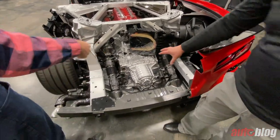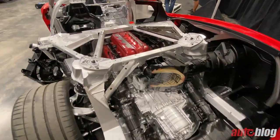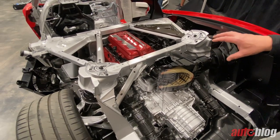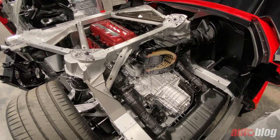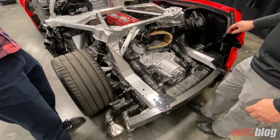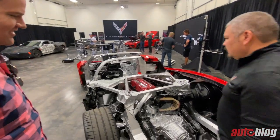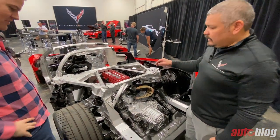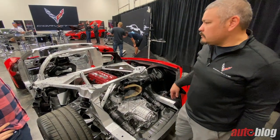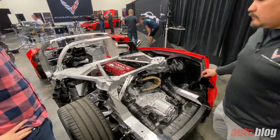The transmission is housed here, mated to the engine. A couple of considerations when you go to a mid-engine configuration like this: as the engine moves, the exhaust doesn't go down — it ends up coming up. You put the engine down as low as you can to lower the center of gravity, which is why some mid-engine cars have the exhaust going up. You also end up with an accessory belt right behind your ears, so you have to pay special attention to noise transmission — that's where the thicker glass and sound abatement measures come in.